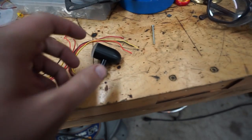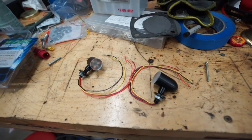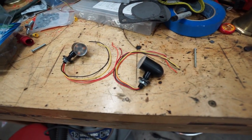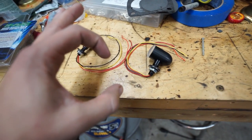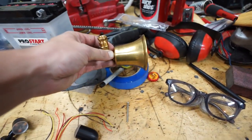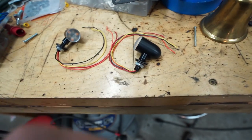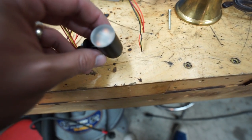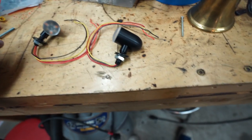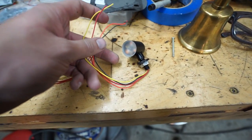These are the lights we're using — they're from X-Arc. I actually ordered some other ones from Amazon that were tail light turn signal combos, but I didn't look at the dimensions. I got them and they were huge — like two and a half inches in diameter, almost the size of the bell we were originally going to use for a tail light, so they totally stuck out and looked pretty terrible. These were about $160 for two little lights, which is pretty expensive, but I really do think they're worth it. They seem like really high-quality metal and they are super bright. They have four wires coming out: a ground, tail, brake, and turn.